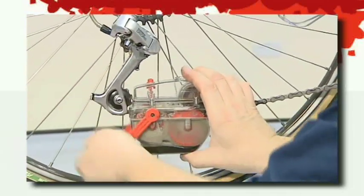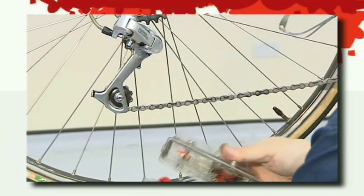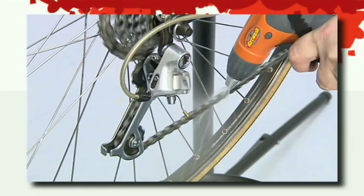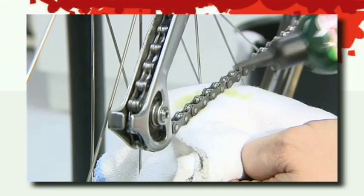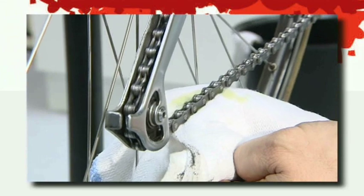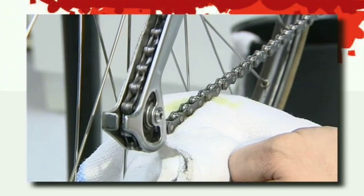After the chain has been cleaned, rotate the arms to release the top and remove the machine from the chain. The chain should then be cleaned thoroughly with water using a light spray, hose pipe, or damp cloth. After cleaning, always apply a good quality lubricant such as TF2 Performance to ensure all the chain links are well coated.